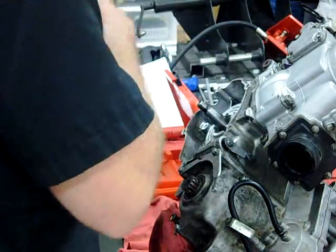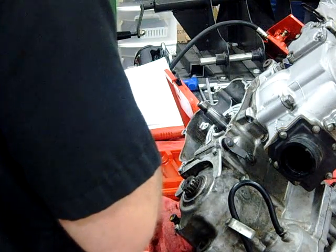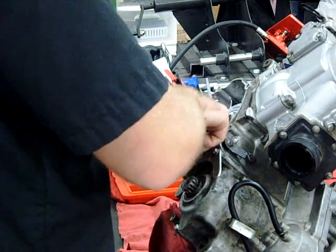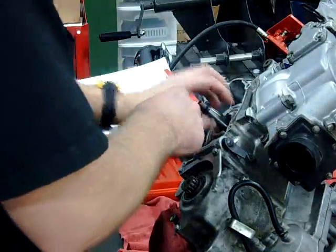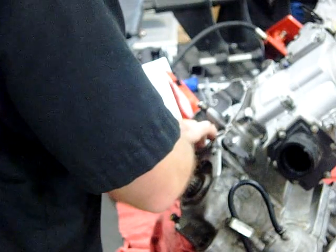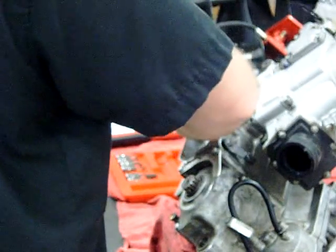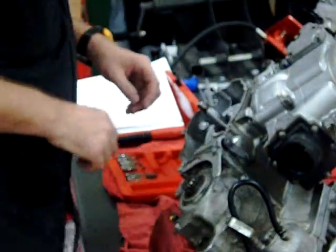There's no way to push it that way — we have to drive the seal from the inside, which means we split the cases. Right here, these bosses — there's no way to install the seal this way; it has to be installed from the inside. So it's a real quick way to identify that. This would also be a great opportunity if we were pressure testing this to actually test the seal and see if it were leaking — it would be a good time for that.